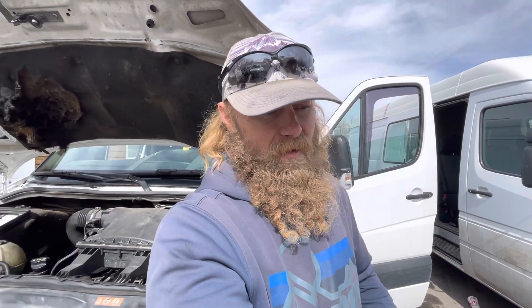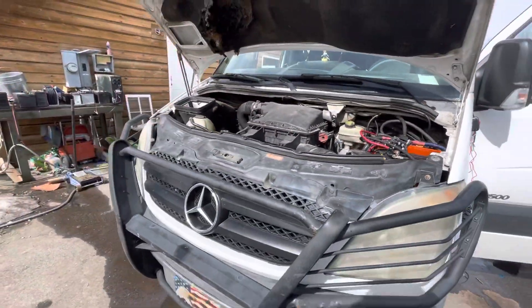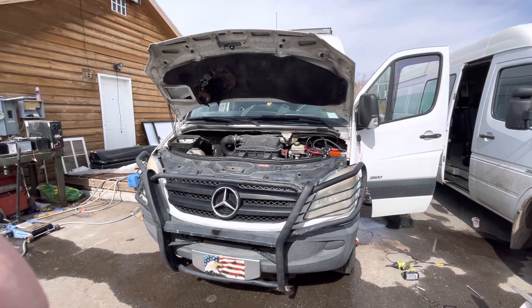If you're building a van, keep in mind the design needs to be focused around troubleshooting just as much as functionality - otherwise it'll just cause problems. If you sell the van, or someone else works on it who didn't build it, or even yourself - you might forget you put a fuse down there and have to pull up floor panels just to check it. People want to keep things hidden and out of the way for a clean look, which is fine, but it comes at a cost if it's hard to access. Keep troubleshooting in mind when designing a van.